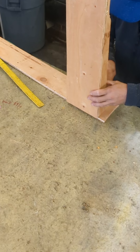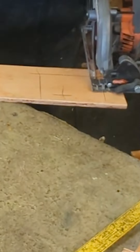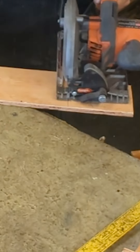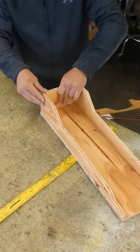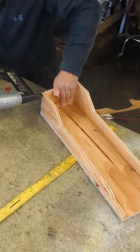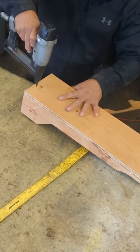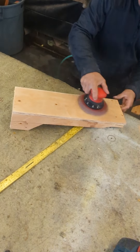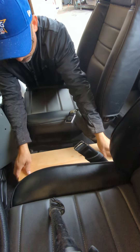I put a lot of wood glue and a lot of staples right there. The staples I'm using are an inch and a half long. Now I cut a piece of wood for the front section. I put glue in there and I hold it with staples. Then I will use a grinder to sand that area. It is not strictly necessary because I will wrap that piece with carpet — same carpet that is on the floor.